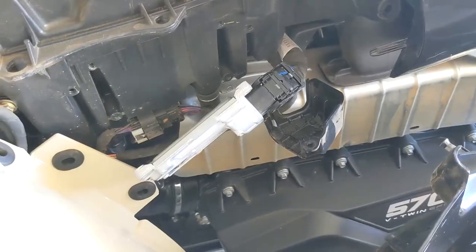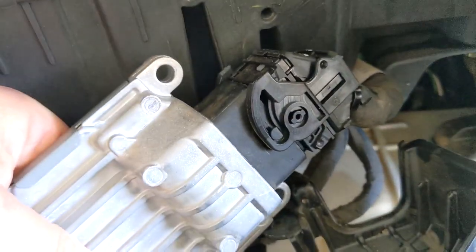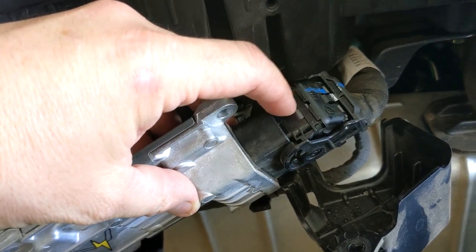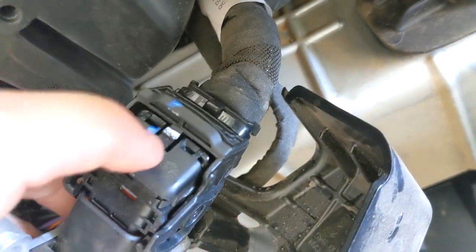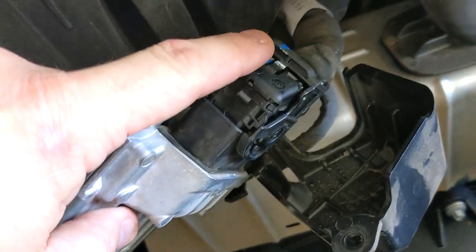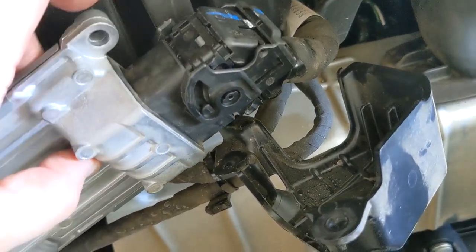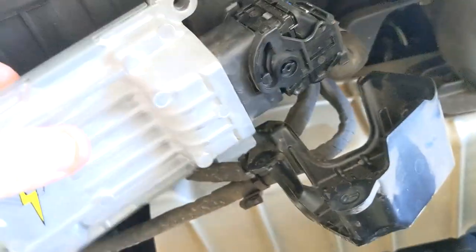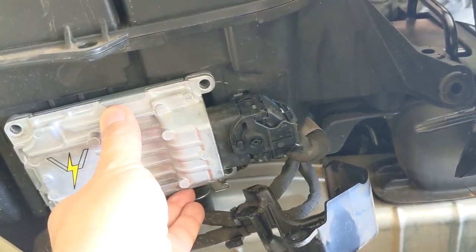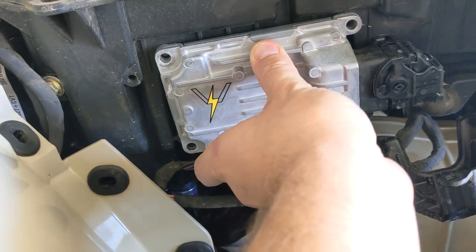So you can see I've got the plug in — I wanted to show you what I was talking about with the clip. The plug has a lever on it. Before installing it, the lever is up. You just release it, push the plug in, then pull the lever up once you insert the plug into the ECU. When you push the lever back there's a little cam and it draws it in nice and even, and you'll hear it click once it locks in. Then put the four bolts back in and pop your plastics back on — you're good to go.